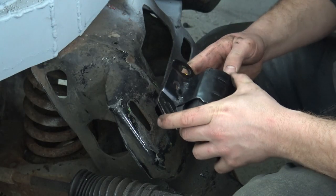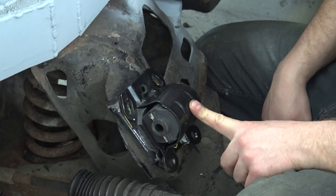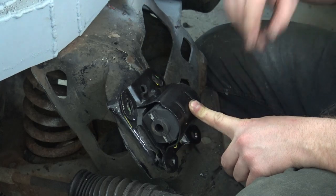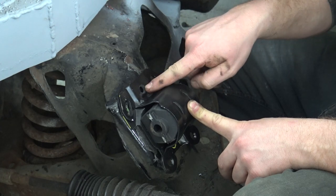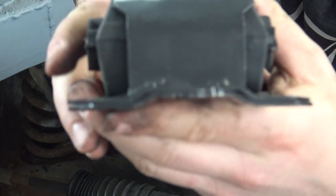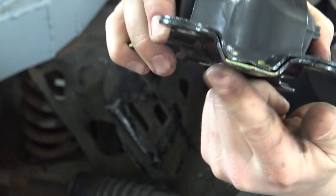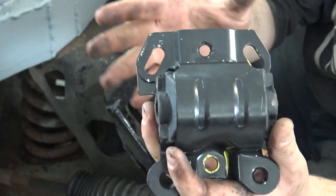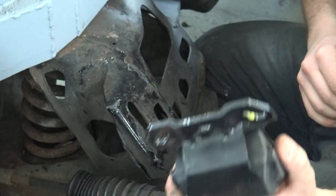I've marked it in three spots. With the motor mounts lined up how they just were, I should be able to get a bolt in here easily and a bolt in here easily — two out of three seem okay, but the third might not be the best, so I may need to use the middle one. There's a lip here and this part and this part sit flat against the frame, same with the middle portion. That's why I chose the middle on the bottom and the top two on the outers. I might end up having to use the middle and put some washers or a piece of metal on the back so it sits flat.